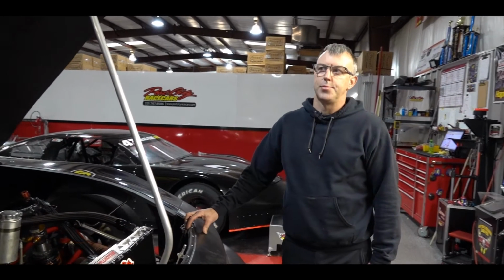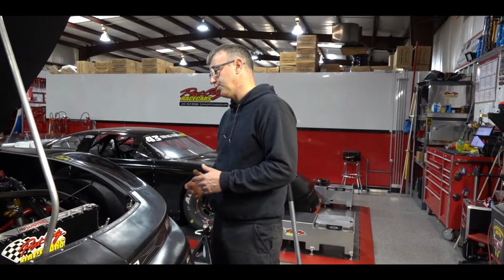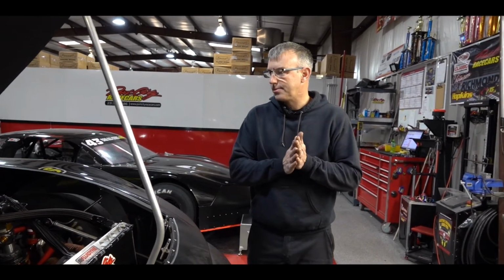So for dual rate springs, if you're talking just the progressive stuff, to me they're better on your cars that can't run bump stops. Your guys like the Big 8 cars, the guys up in the Northeast, Canada, whatnot, that aren't allowed to run stops, got crappier shocks or low budget shocks.